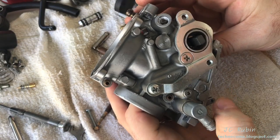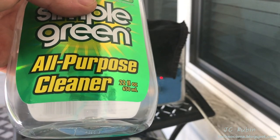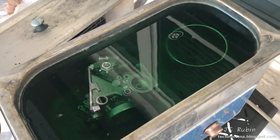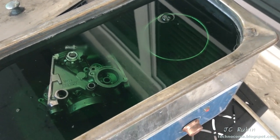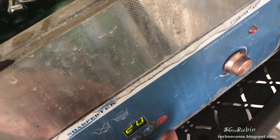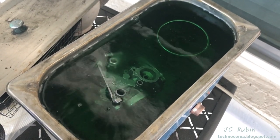At this point this carb is now stripped and ready to go into the tank. Got the ultrasonic bath cooking up now — 650 milliliters of Simple Green, the rest topped off with distilled water. Got the carb and pieces in here, let it come to temperature at around 60 degrees centigrade. We'll set it up for 20 minutes and do about two 20-minute sessions, inspecting between each session.